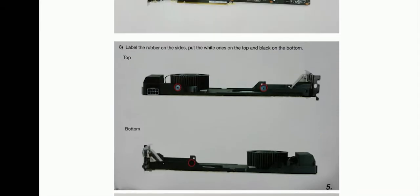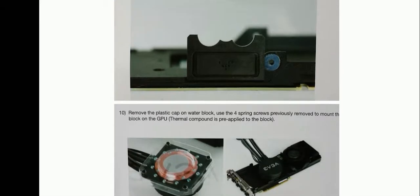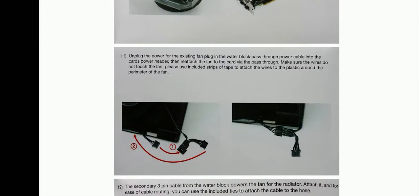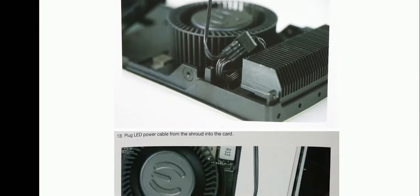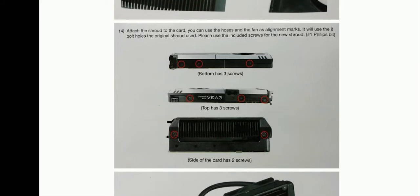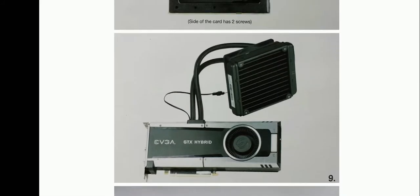Yeah, it was really not that bad at all. I think anybody can do it. The screws on the card were kind of loose already, so you want to make sure you don't over-tighten anything once you put everything back together. Before we begin, you're going to need some tools: a triple zero Phillips head screwdriver, a size one Phillips screwdriver, a two millimeter allen wrench, a four millimeter allen wrench, and a 5/32 hex driver to take off the screws on the PCB.